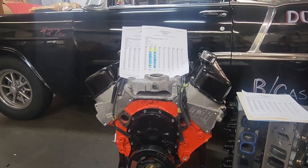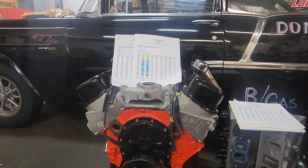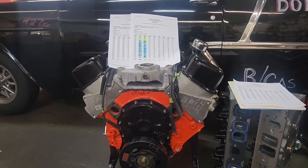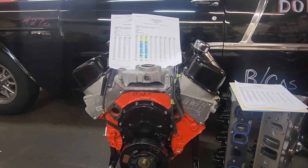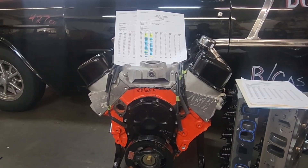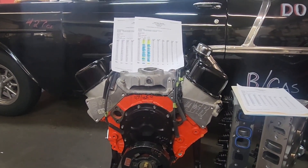Before we get into the results, let me go over the dyno results. I had a viewer on one of my other videos point out that I do a lot of videos on dyno tests and give very little information, so let me slow down. I usually post the information and specs in the comment part of my videos, but let me go over this motor with you so you know what you're looking at. I run a Pro Systems 1000 CFM carburetor, 4150 style carburetor, and I've got an Edelbrock RPM Air Gap.